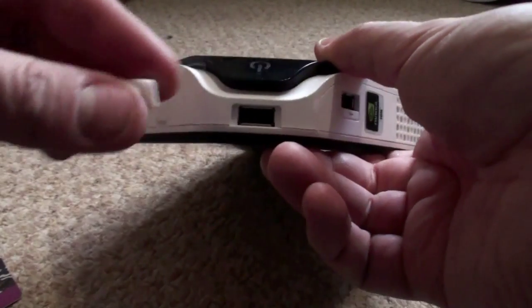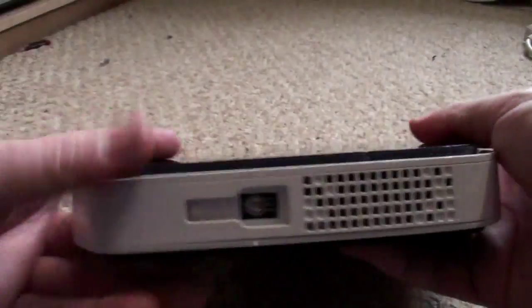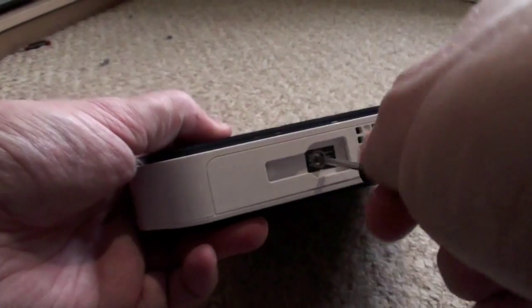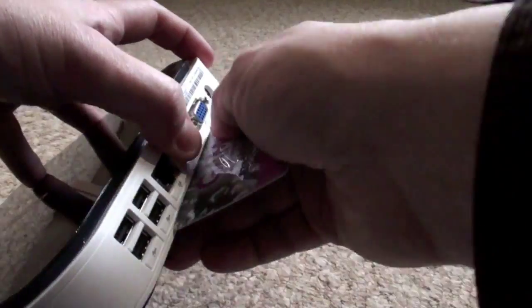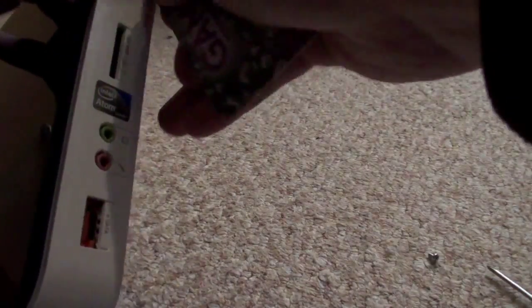The model I got was the base model in the 3610 range, which runs Linux and comes with one gig of memory and wireless B/N/G networking. I needed wireless N and Windows 7, and for that I needed at least three gigs of memory, so I had to take it apart. This screw I'm removing is behind a sticker warning that you'll invalidate your warranty. That's the only screw. I'm working a credit card around the edge and snapping it open bit by bit - it makes some pretty worrying cracking sounds, but you just need to work around slowly so you don't snap any plastic lugs off.